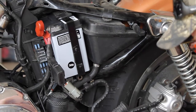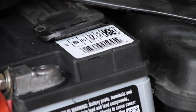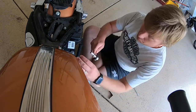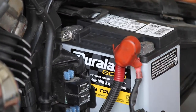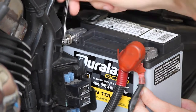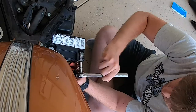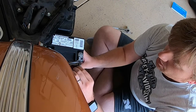After you remove the nut, look at the top and you'll find that it hooks around what looks like a plastic belt loop of some kind. After you take it off, you'll be able to remove the battery. This next part can get a little bit tough, so I recommend grabbing the 10mm wrench. Pull the battery out as far as you can and use that wrench to reach the node in the back — that's the negative node. It's important you remove them in this order to avoid electric shock. After the negative node is out, you'll have more leverage to take out the positive node, so I went back to the ratchet because it is an easier tool. Once both ends are removed, you'll be able to remove the battery safely.